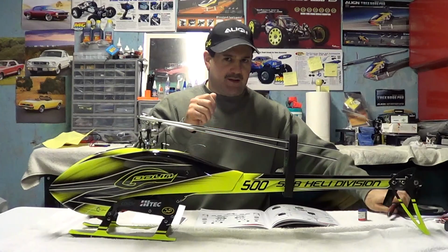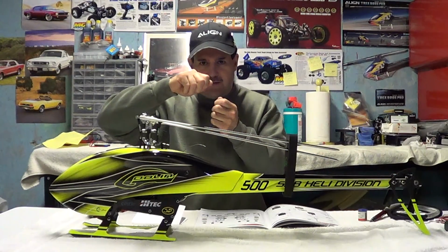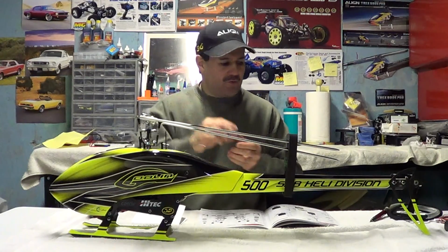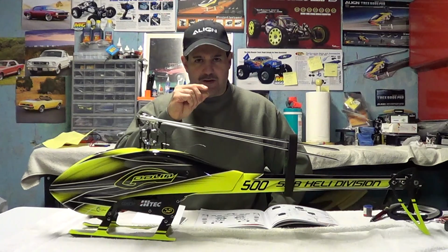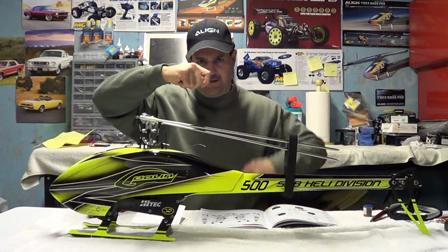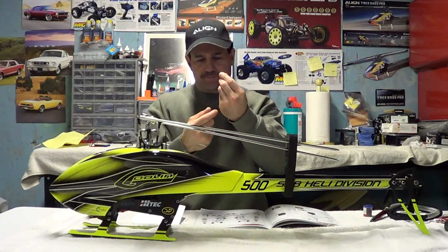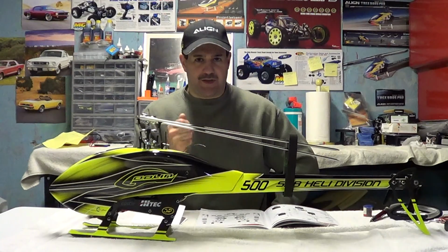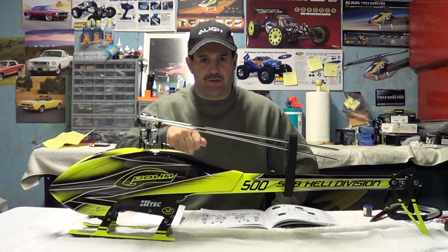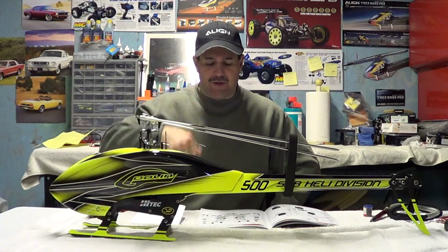Once the hole was colored in, I put a little tape on either side of that black spot. Then you just gently keep this on low and slowly go back and forth, back and forth, back and forth with the disc until you make a flat spot. You don't got to go crazy. Make it enough where you can catch your fingernail on either side. Then put your bushing back over and make sure that it looks good. But be careful, guys. Keep the gun on low when you do it. Don't go crazy or you'll dig right through that shaft again. Just a gentle movement back and forth until you make a flat spot.